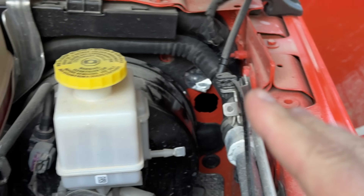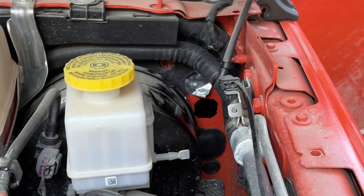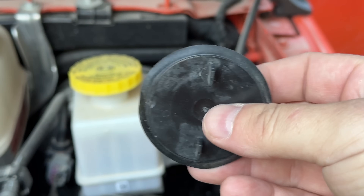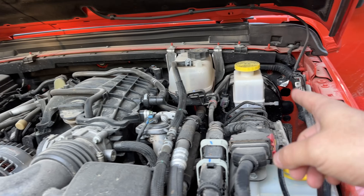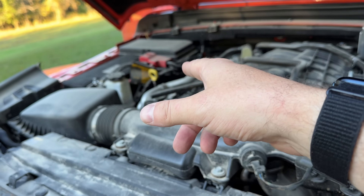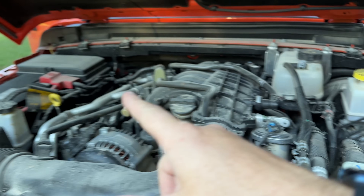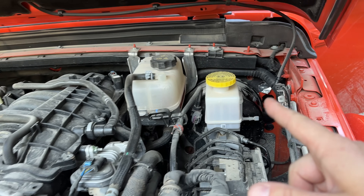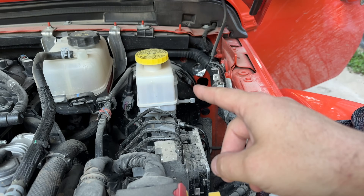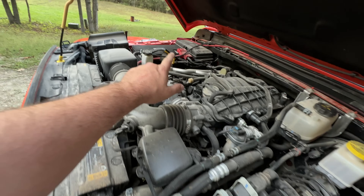To make this much easier, I used the grommet near my brake master cylinder. I popped that grommet out, drilled a little hole in it, and ran the cable through that. That hole is much easier than trying to go through the main wiring harness on the passenger side. If you're entering your passenger compartment from under the engine hood, I highly recommend entering through this hole close to the power booster. I've got the cable run — I haven't hooked it up to the battery yet because I want to wait until everything else is set up.